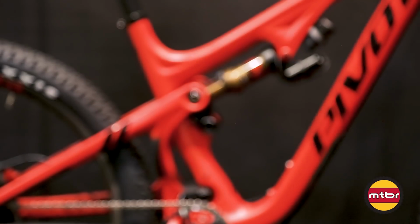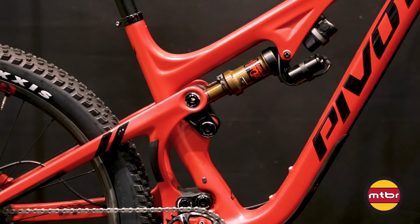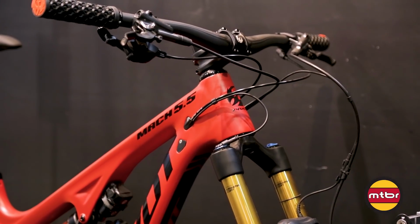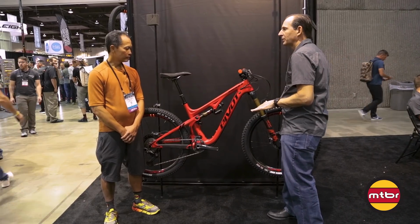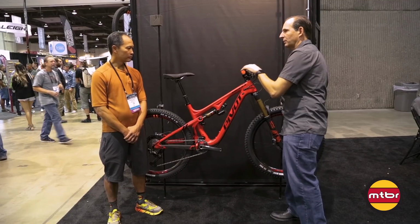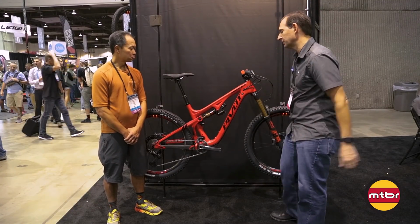It reads the ground 1,000 times a second and can make a valving adjustment in 3 milliseconds. That's faster than a human can feel anything at the handlebars. So the front end hits a bump, the suspension opens and gets plush before you feel anything at the handlebars, or before you can lose traction or upset control of the chassis at all.